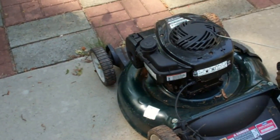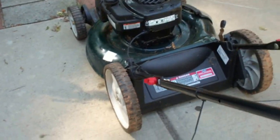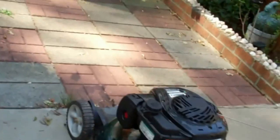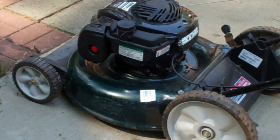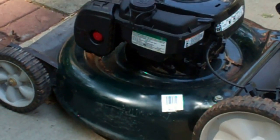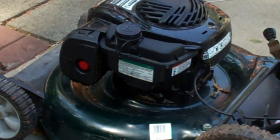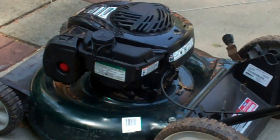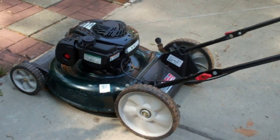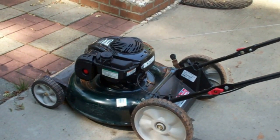So, well, cool. I guess, yeah, quick clean out of the carburetor. And yeah, like I said, I wasn't getting gas, the plunger wasn't priming properly, so must have got whatever junk was causing the problems, and working good now. So awesome. It saves me a $75 charge.